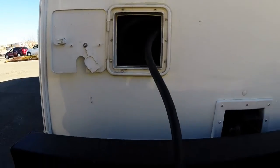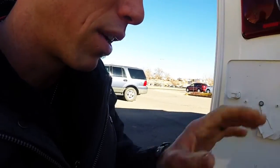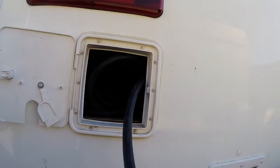Real quick here, on this 2014 Coachman — there's only a couple units like this — they are pretty efficient. What you'll find is this power cord coming out of the back that we're plugged into. What you'll need to do is pull off the adapter, and in here you'll find a plug. This plug basically completes the circuit when you're running the generator. If you're out in the desert or wherever, not hooked up to shore power, and you have your generator fired up but you're not getting any juice, that's because the circuit's not complete. This unit doesn't have the relay — or the inverter — that switches over the generator power so you can run it on the plugs. So what you would do is pull off that adapter and plug that 30-amp plug right back into itself, and that completes the circuit for the generator power.